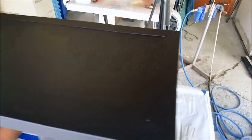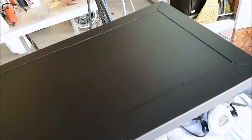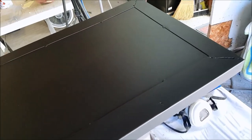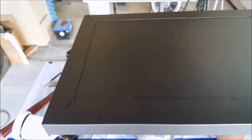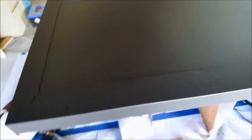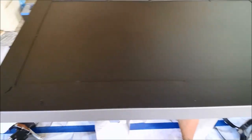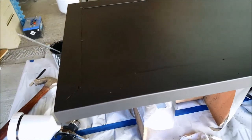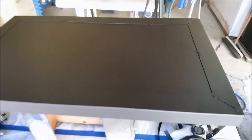This side is all done, dried up, and ready to go. I'm going to flip this over and reload the gun. Something I need to mention: when you're working with this kind of paint and you have to let your gun sit for a bit between coats, you need to dump your gun out and put some thinners in there to keep things from gumming up — that's just the way this paint works. I didn't have enough flat black left, so I mixed in some gloss and added it to the flat black just to shoot the inside.